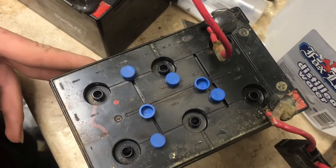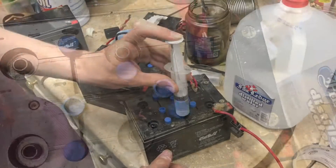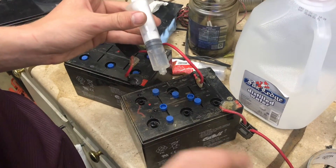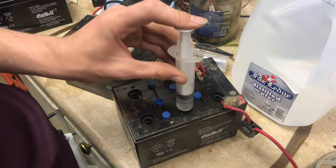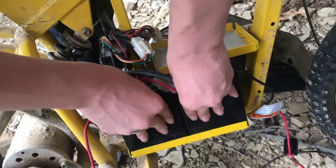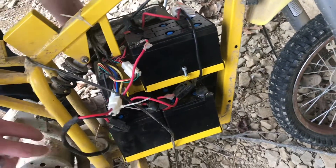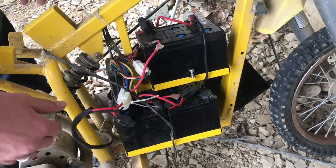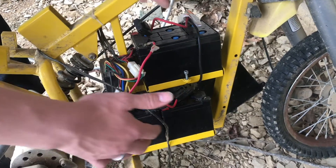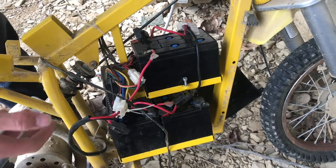Here's another battery — this is one of the ones from the bottom. It's fully charged and there's no liquid in there. As I'm filling it, I'll just give it a tap so I get an idea of where my water level is. Now we'll put them in and charge them up and see if any of the caps pop — I'm expecting a few on the bottom too. We just need to make sure we don't have the top plates on whenever they want to pop off, because we want to let them overflow if you have too much water.